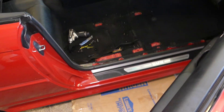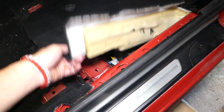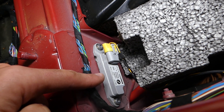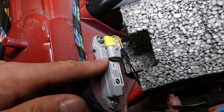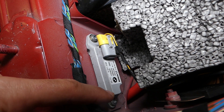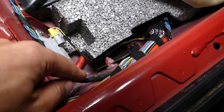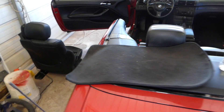Once you remove your seats, you will need to remove your trim molding right here — that trim piece — and lift your carpet up. Right here, this is your side crash impact airbag sensor for the right side of the vehicle, made by Bosch. Every time you remove the seat or disconnect one of those, you have to disconnect the car battery at least one hour before you do that, because that's part of the airbag system. All you have to do is remove two screws — one here, one there — and disconnect the wire by lifting it up and pulling it out. Super simple. You have some ground wires, so be careful not to damage anything. This is for the passenger side.